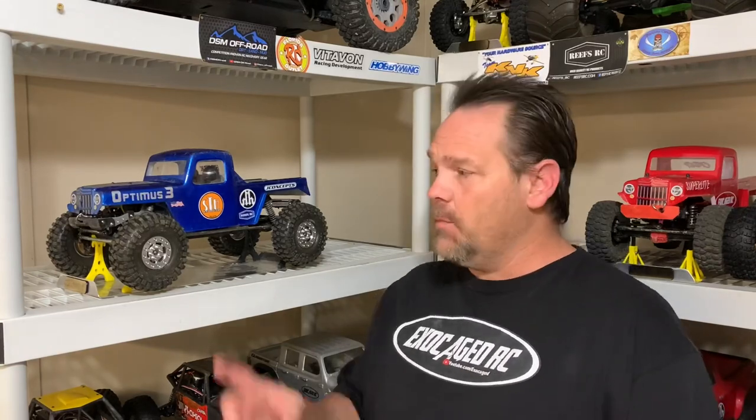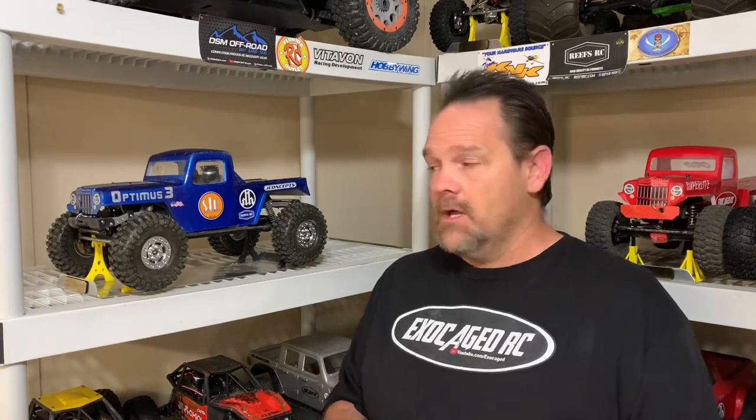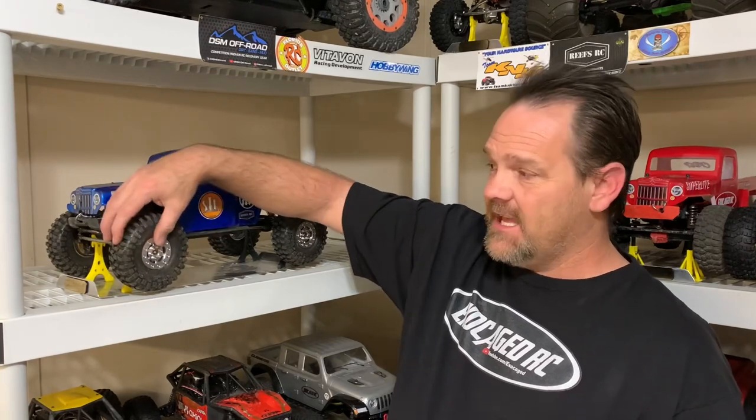I got it on the first try. I like how the tires are conforming. I like how they're wrapping. I like how the sidewalls are holding up when it gets into that inner foam. Now I've done the foams that were really hard, where you have just about this much tread flex. When you're trying to get up a ledge and the tire is really hard, the tire won't absorb the hit — it'll just hit it, boom, and transfer to the axle, through the links, through the shocks, right into the chassis. Then you have the whole vehicle bounce back and could actually roll you. Having the tire able to absorb the impact to a certain degree is a benefit, especially when you're trying to bounce up a ledge.